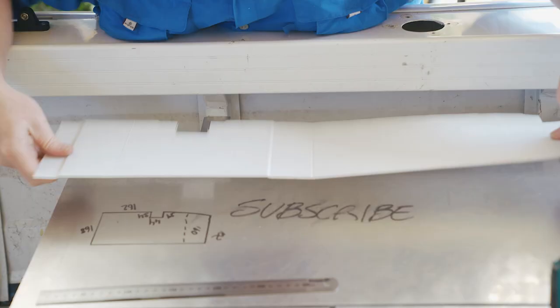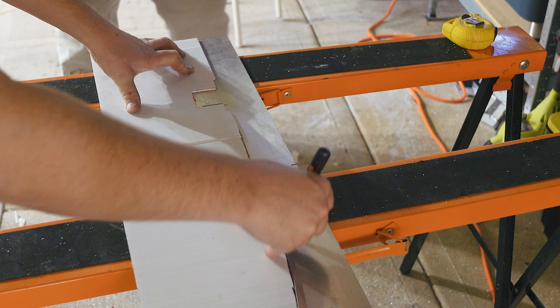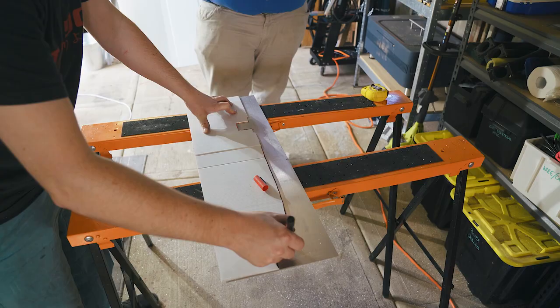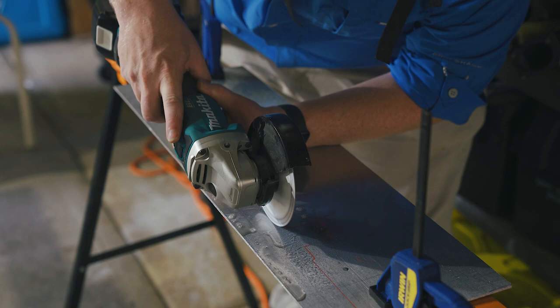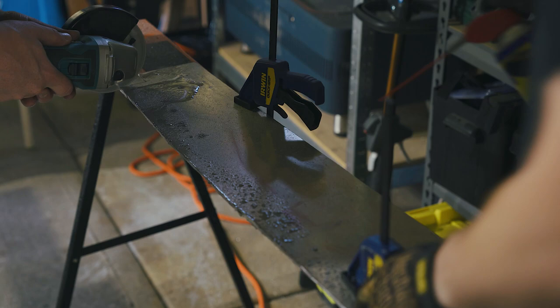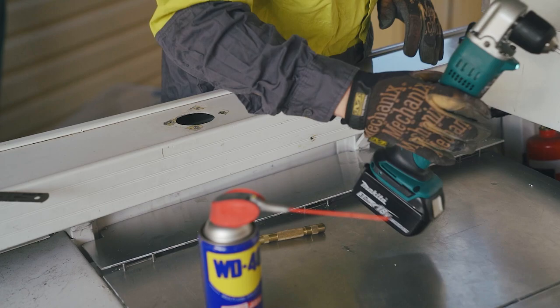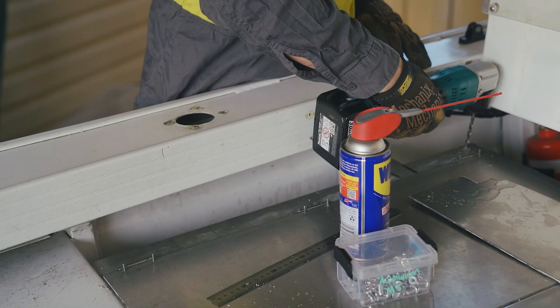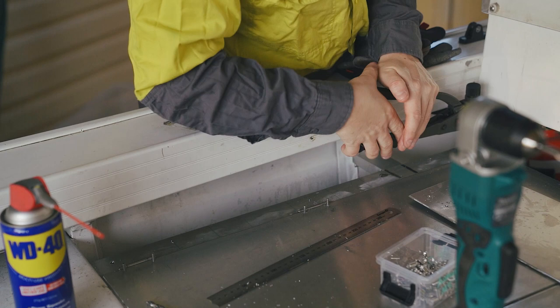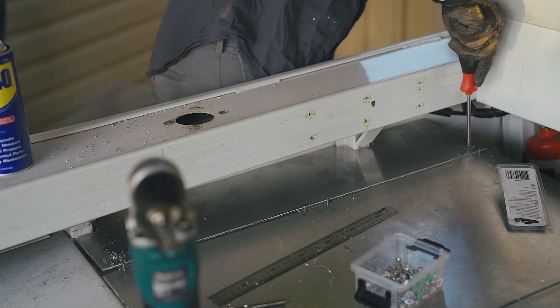The side modules have a large gap underneath the gunnel, and I'll save you the templating process as we've touched on that quite a few times. I wanted to try cutting a complex profile using the angle grinder instead of the jigsaw, as the jigsaw is a bit of a pain to set up properly. The angle grinder with the diamond wheel worked well but definitely benefited from some WD-40 lubrication. I couldn't say the final result was any better than the jigsaw, just that the process was a little faster to get an equitable result. These side skirts are the only panels besides the floor panels with fasteners securing them from the top, as I couldn't set a rivnut into the sheet panel and pull it into the frame the same way — the frame uses an open channel. Let me know in the comments if you can think of any ways I could have made a removable panel without fasteners through the top.